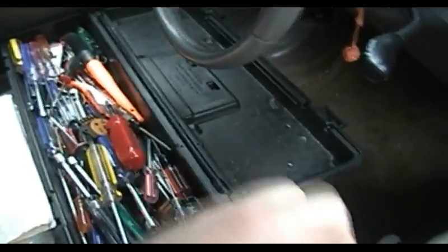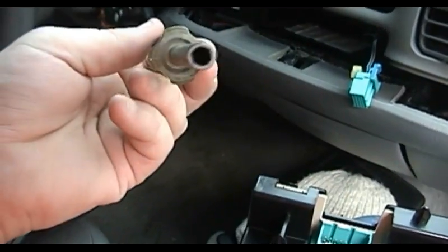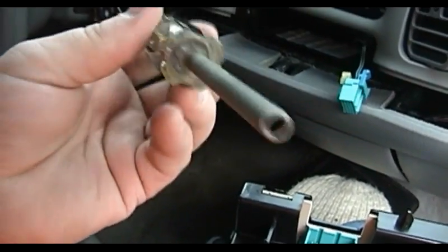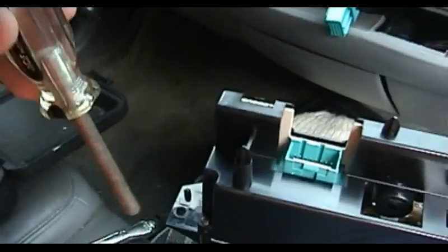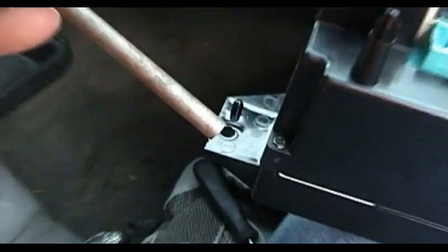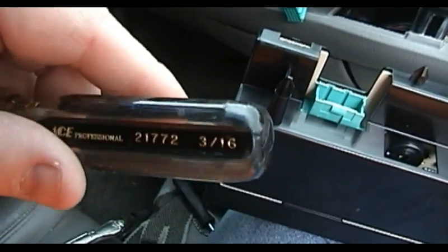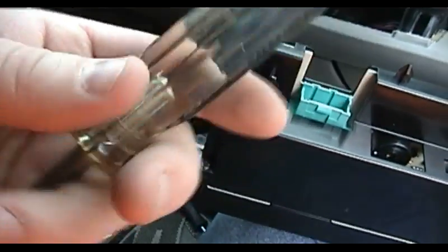And here, my computer twiddling tools do come in handy. This particular little nut driver is used for re-securing those knurled style nuts that you find on the sides of computer ports like parallel ports and VGA connectors, DVI ports, serial ports, you know, ports that real computers still happen to have. But even weenie modern computers can oftentimes benefit from the use of this tool, and as luck would have it, they are exactly the same size. This is a 3/16 inch nut driver, the finest that Ace Hardware makes, I'm sure.